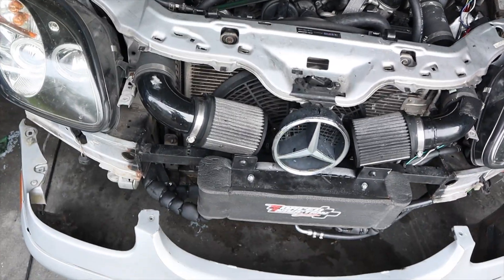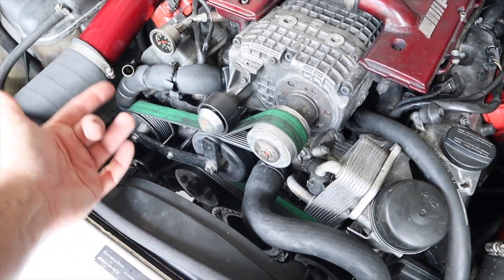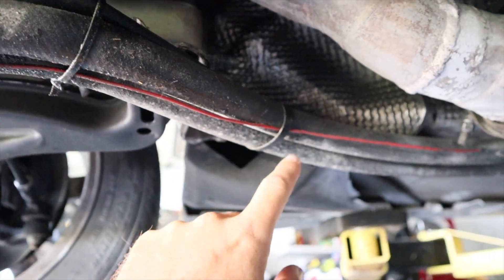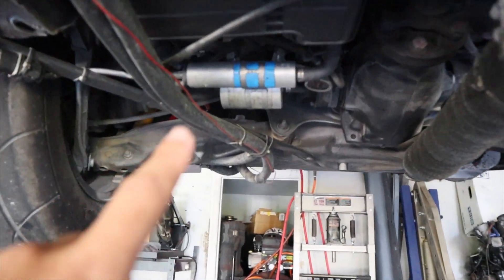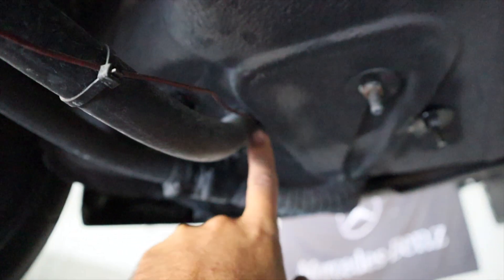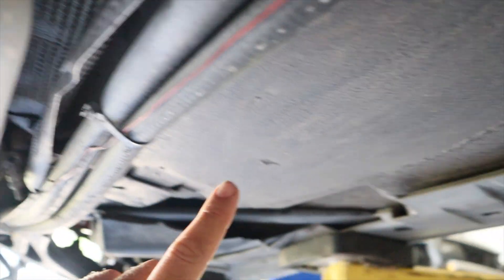We got the top all done — it's all insulated and routed, goes down there, everything fits. Now for the bottom, we're going to make the hoses bigger and get them away from the exhaust, routing it more along this way and dropping it back in all the way back. I already have one hose that's pretty much already upgraded. It's going to branch from here and then this one will go all the way up to the tank — pretty much a straight shot away from the exhaust.